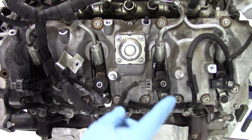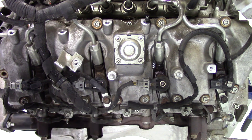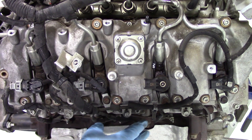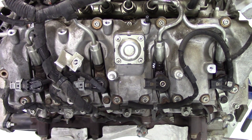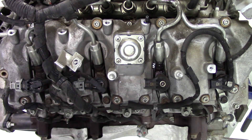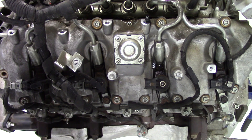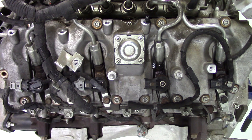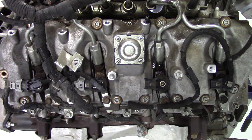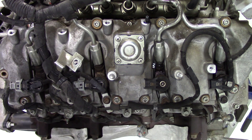Make sure you do it that way because if not, you end up with a broken tube and usually have to replace the entire line. Before you do anything else, make sure you pull that T out correctly without causing any damage. Now before we can actually pull the injectors there are a couple more things to do — first, pull the pigtail off and get it out of the way. Viewing through the fender well gives a great view of cylinder number six just over the tire, providing access to the actual fuel delivery tube. Using a wrench through the fender well, get to the tube and turn it one turn at a time to loosen it, then from the top side use an offset wrench to get a couple of turns at a time. It's tight but doable for cylinder six without removing everything around it.